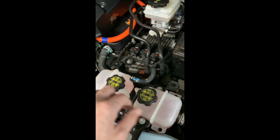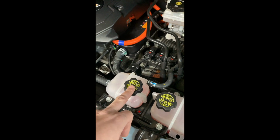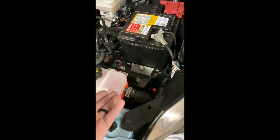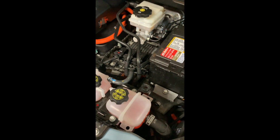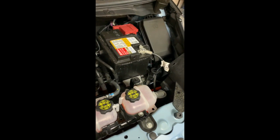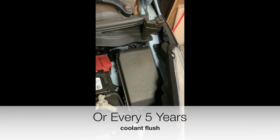The other two coolant loops out of the three are the TPIM traction module and the accessory module. The other is what cools your cabin through a heater core style heating element. Now this coolant will not degrade like other coolants that are subject to the combustion process, so this coolant is going to stay fresh for 150,000 miles. That is the recommended interval to change this coolant out.